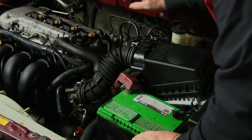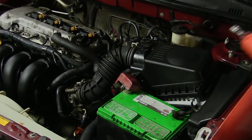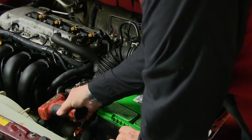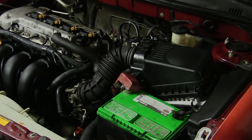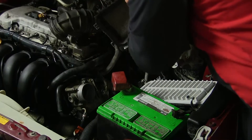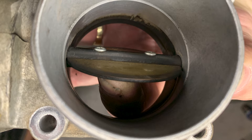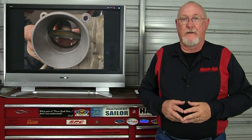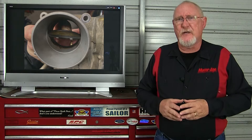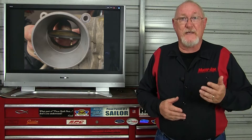If no codes are found, proceed with your visual inspection. Remove the intake air duct to access the throttle body. It's not unusual to see deposits building in the throttle body near the throttle plate. As these deposits build, they can reduce airflow past the throttle plate and into the engine. The ECM can only correct for these buildups so much, so it's not a bad idea to recommend to your customer that the throttle body be cleaned periodically — about every 50,000 miles or so, or as outlined in the OE maintenance schedule.